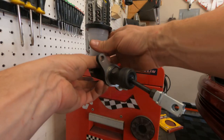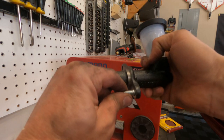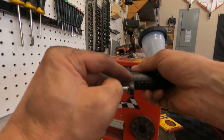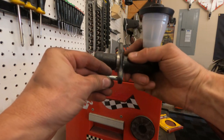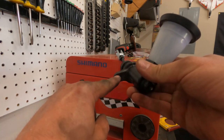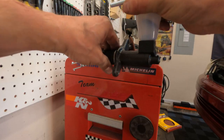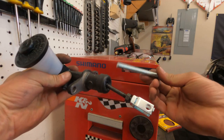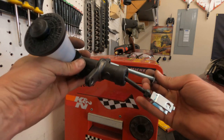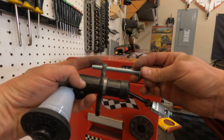If you're using the Land Cruiser clutch master cylinder, you're going to need to drill this stud from the top — that'll loosen it up and allow you to unscrew it out of there, because you want that to be an open hole. I loosened it with some pliers. This hole is threaded and I am using a three-eighths bolt, so I'm going to have to drill the hole out. This is going to come through the firewall from the inside into the engine bay, and then we're going to run a lock washer and a nut on that side.